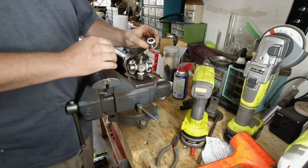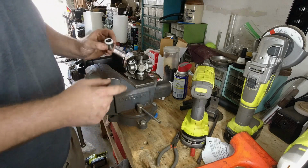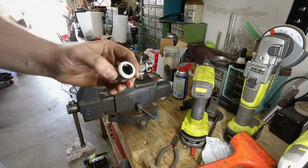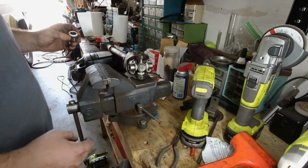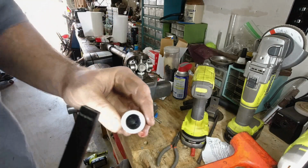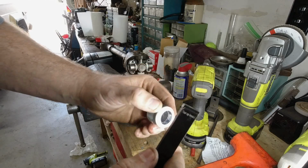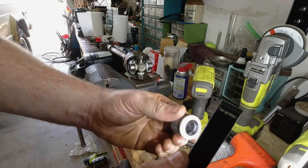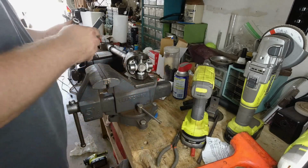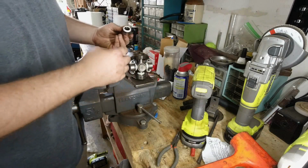Okay. So, those of you who haven't done this before on a regular drive shaft, the scariest part is the little needle bearings that are in there. Damn, I threw away all my old ones. But the little needle bearings aren't held in there, I don't know if you'll be able to see it, by anything other than the grease that's in there. Alright. See those cylinders that run around the outer edge? It's called a needle bearing because it looks like a needle and it rides around as it spins around that metal shaft. And it's pretty easy to knock one loose, have it fall over, and just totally wreck your day.